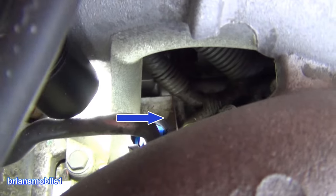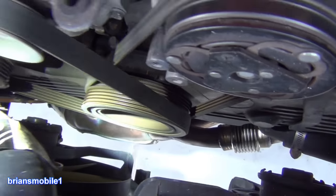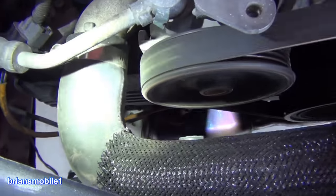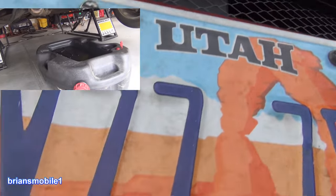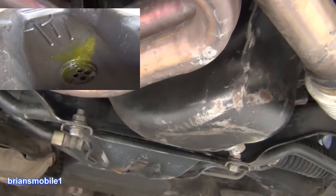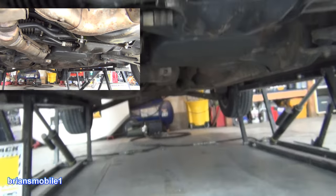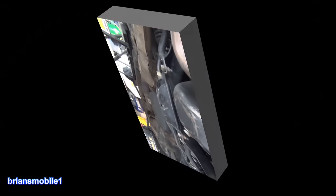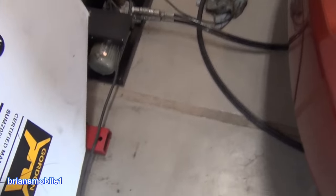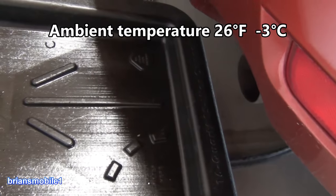And you can see the head gasket, copper colored. We've got a new catalytic converter in it because the old one was full of oil and antifreeze and was badly coated and had to be replaced. So when we go underneath, we used to see a little waterfall dripping through here of oil, or oil fall, I guess you'd call it. And now I don't see any oil pouring out the tailpipe. Let's see what we got going on here. Understand that gray concrete doesn't show smoke so good. So we've got something black in the background.